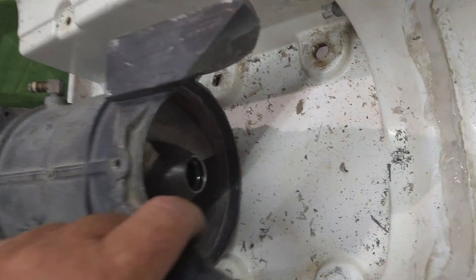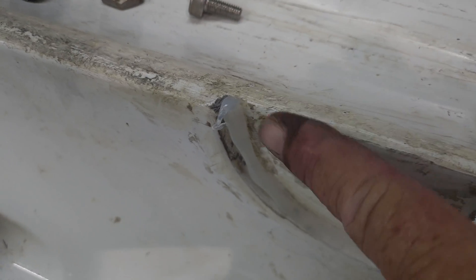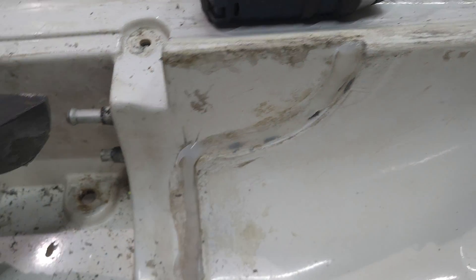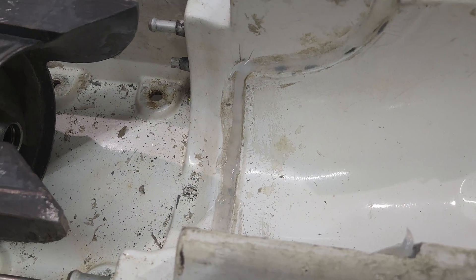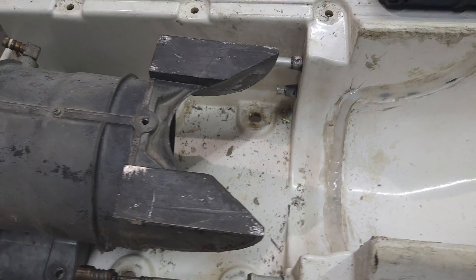You can see we're getting ready to put the pump in. We've got the impeller installed nicely. Pump turns over nice. We've run a bead of silicone down along here on both sides. And that's all we do for now — we will do this line here after the pump is installed because it just becomes a mess to do it otherwise. And you can see we've cleaned off all the extra silicone, removed all that. We try really hard not to induce more silicone onto this gel coat because silicone does weird things to water. So we'll get that installed, get that bolted up, and start working backwards on the pump.